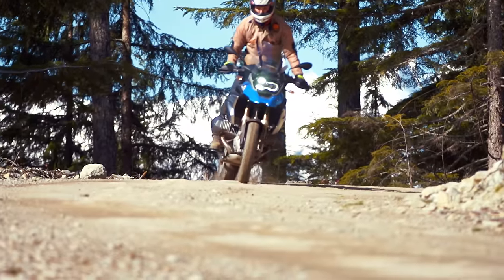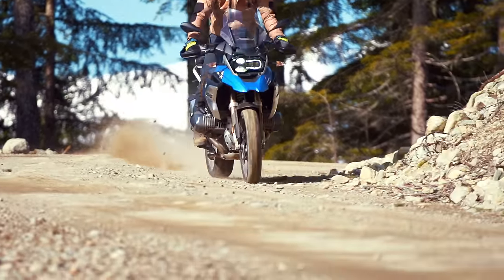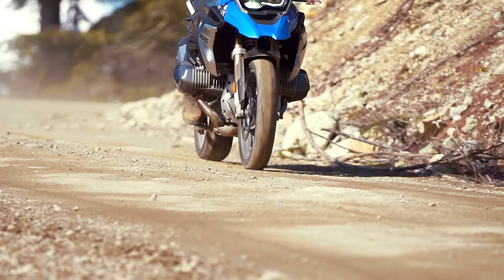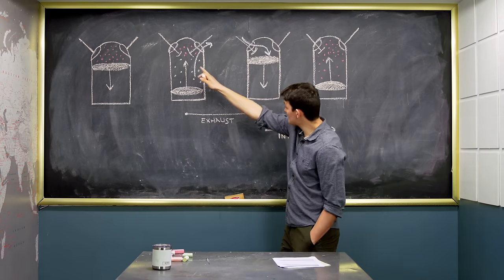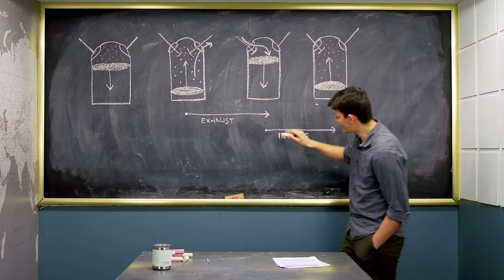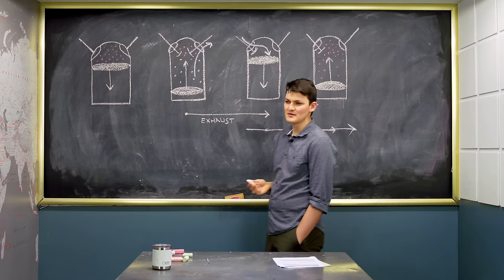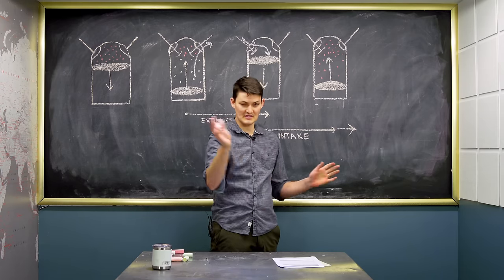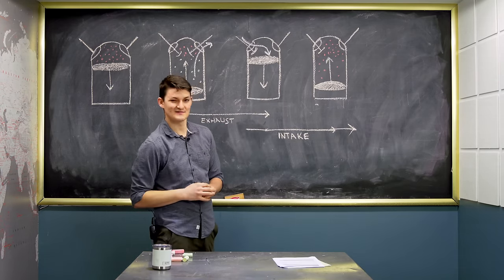Another hiccup: 134 horsepower is frankly not useful off-road. But again, the GS is flawless in every facet, so I must be missing something here too. We know BMW made the intake valve open earlier and stay open later at high RPM — they added valve overlap, hence the brilliant sport performance. But off-road, either our GS ignored low RPM grunt, an absurd notion, or there's more to the mechanics of how this is done.